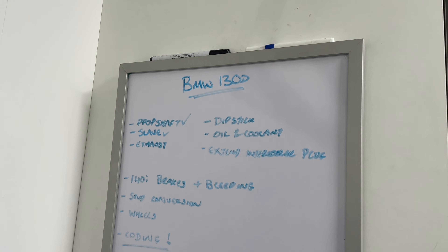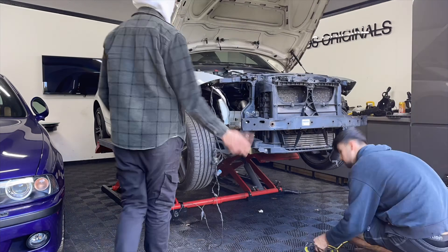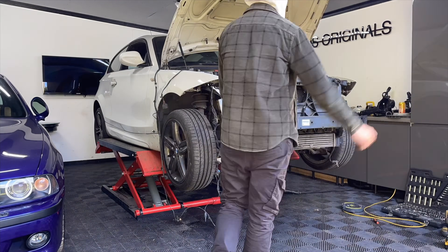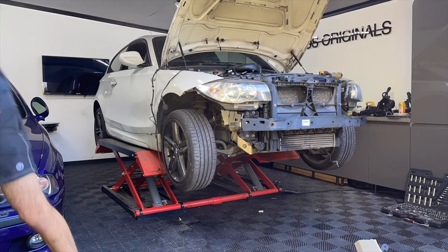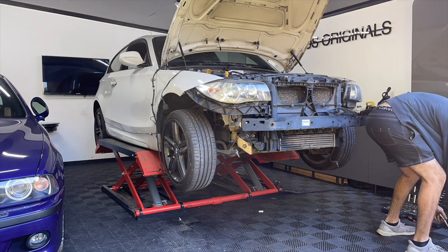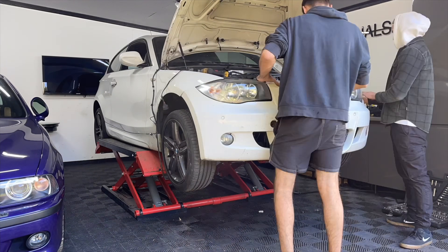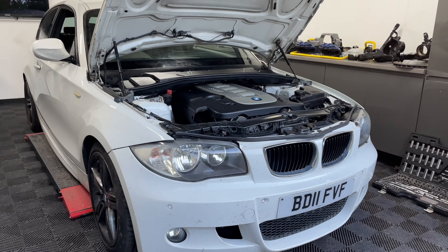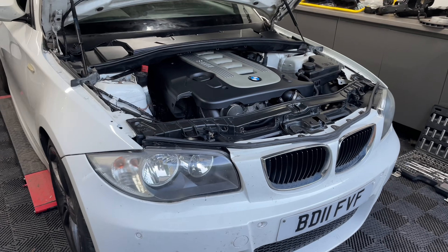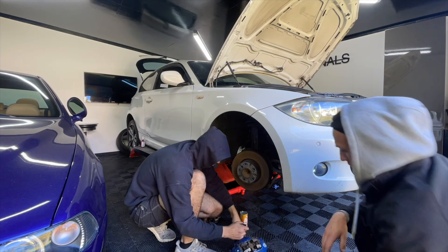One of the next difficulties you'll come across is the front end. You'll need to make some modifications to coolant hoses and also to the slam panel. The slam panel we ran was actually off a 135i, as it enabled the larger rad to fit. With a little bit of trimming you'll see this all bolted straight up. With a little bit more time and effort we managed to make it sit better, and as you can see here everything sits perfectly and looks very OEM.